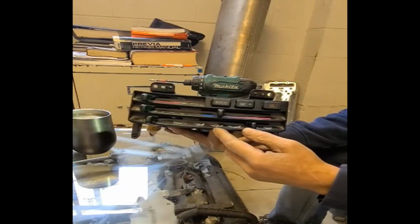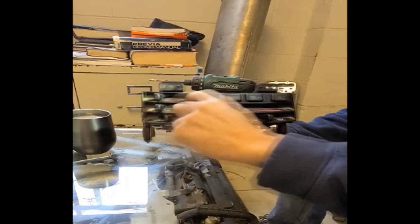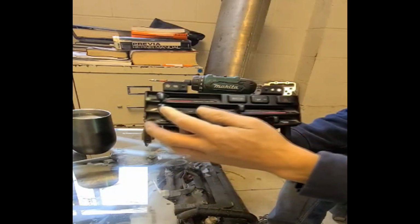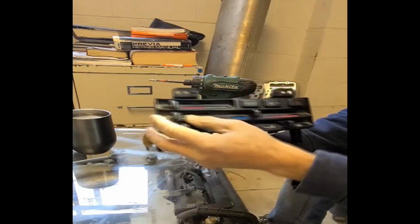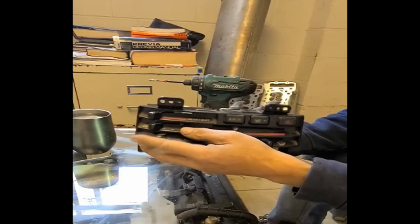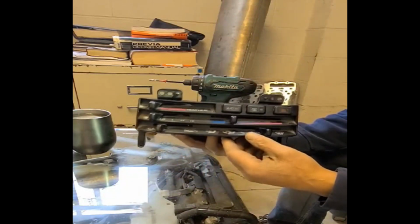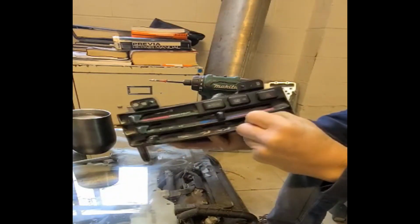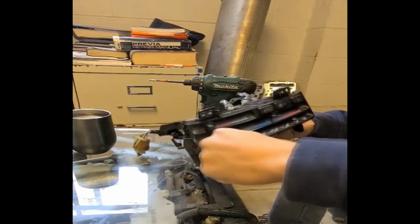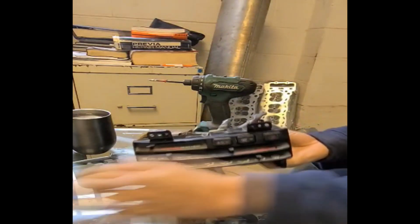I just want to run through it and show you, because some of you had the problem taking things apart, especially this heater control unit here. So it's easier to do it now. I can show you a really easy way to do it because it's out, right? First things first, you just pull the knob out. Just pull right out. That's the first thing.